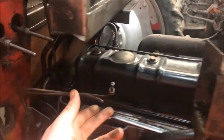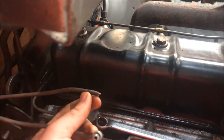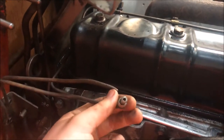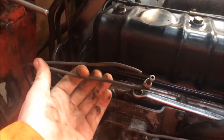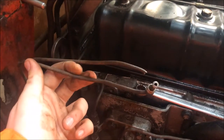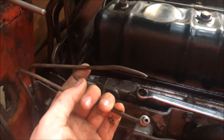I've removed one brake pipe, but unfortunately the other union snapped off — corroded up. This one came off fine and released the pressure. I thought, by the tyre marks and little skids on the road, that was the one causing the problem. I got it to move until I got it back outside the workshop, and then they locked up again.